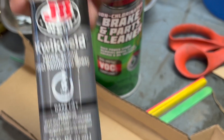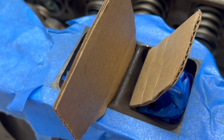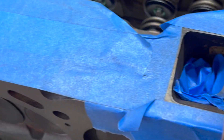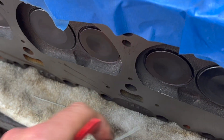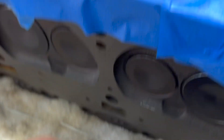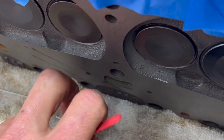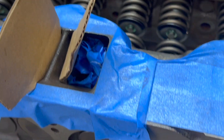I'm gonna mix it up. You can see I've got some cardboard to hold the JB Weld in place. I'll mix it up with a popsicle stick, put it on there, and I'm going to put a piece of stainless wire in it. I'm hoping that'll give it some strength so the exhaust doesn't blow the material away. So this is experimental — you're all here for the journey.